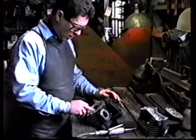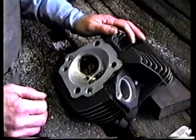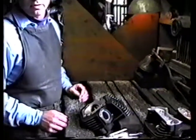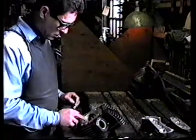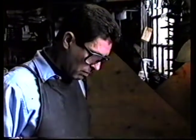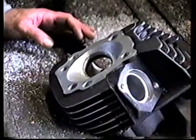I ought to mention the fact that when we take this metal out of here, we are lowering the compression ratio slightly — we take out about 8cc's. It's not a significant difference in compression, and we find that the improved flame travel actually increases the horsepower over the amount of compression that was previously in the cylinder head. This is a great advantage in a lot of respects, so we do it to all of them. We match all of them to the bore size, we make the chamber totally hemispherical, and you'll appreciate it if we do yours.